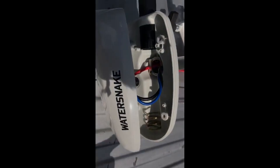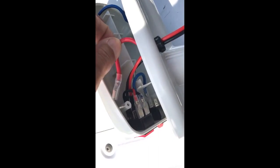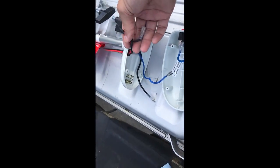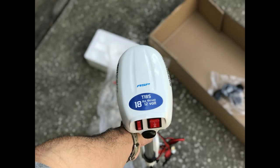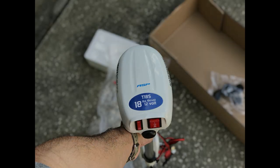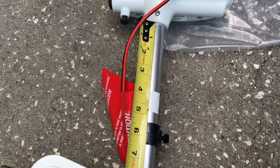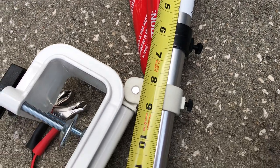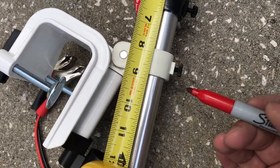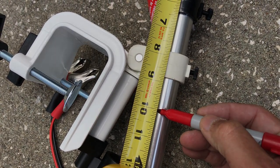In this video I'll walk you through step by step doing the entire mod. One thing you don't have to do is cut the shaft on the trolling motor — that's your choice. But you still have to disconnect the head unit and disconnect the wires. Once you take your trolling motor out of the box, first make sure you have everything from your parts list. Next, measure how much you want to cut off the shaft if you choose to do that. I personally measured from the bottom of the head unit, went 10 inches down the shaft, and marked it to be cut.